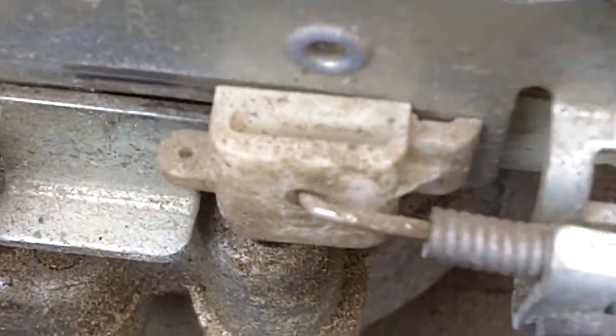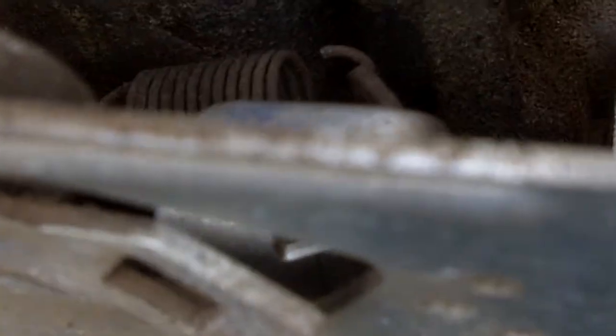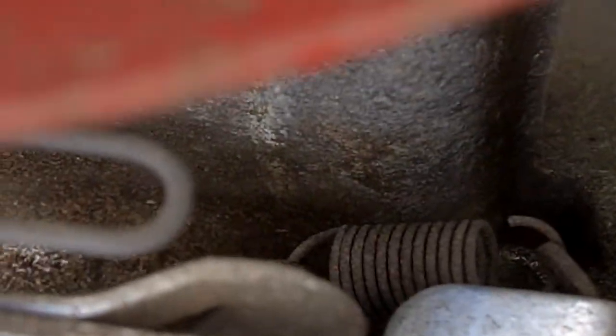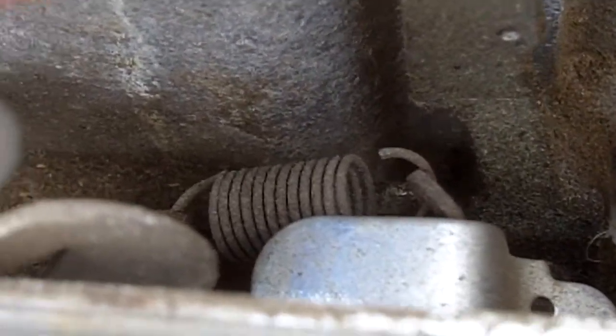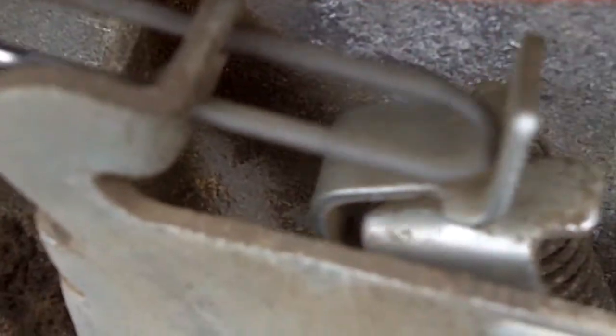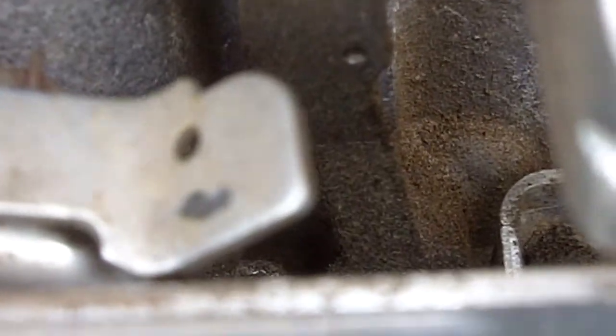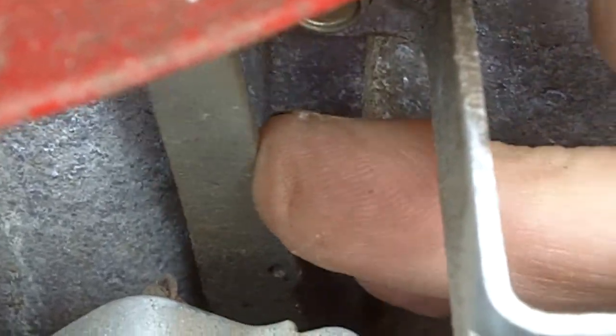Here's a close-up of that metal plate because there are some pieces on the inside. There's a spring where it presses on the choke. When it's all the way at the bottom, you can see it press on the governor. And when it's released from the governor, you can see this arm can move — and that's controlled by the engine speed.